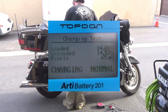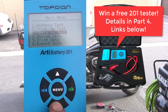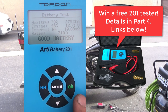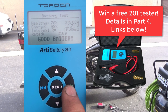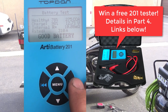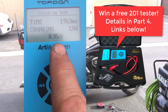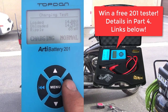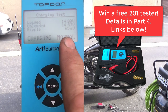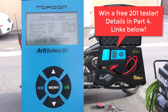Let's move on and look at the results and show the printer feature. Now that we've done all the tests, we can go ahead and pick the review data, hit OK, and toggle through everything quickly. The battery says it's good — state of charge, internal resistance, we don't have a spec for that, the rating we rated it at. The crank time says cranking low, 8.95 volts. The charging system test shows loaded and unloaded values, which you'd compare with specifications found in the service manual.